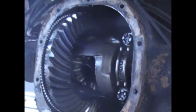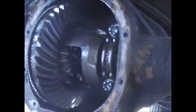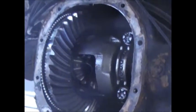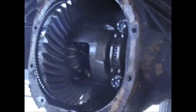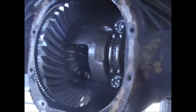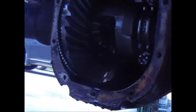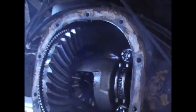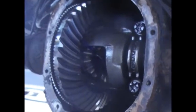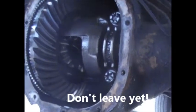If I had to do it again I'd probably go buy one of these locking pins - a couple of bucks. This is the first differential I've ever worked on. I would never put a used pin back in considering this one somehow broke - it has me concerned about why it broke. Got the axle out, pulled the little C-clip out - plenty of videos on that. Push the axle in a little bit, push the C-clip out - not a big deal. Hope it helps somebody.